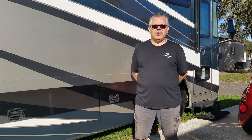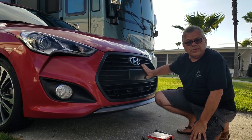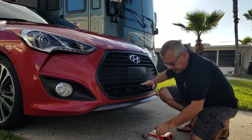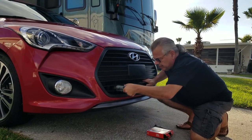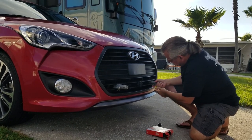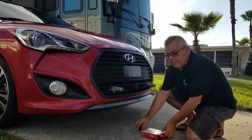We're going to show you how we prep the vehicle for towing day. This is the day before our move. One of the reasons we went with Blue Ox was it left a nice clean look across the front of the car — from a distance you really can't tell it's set up for flat towing. To get it ready, all you do is remove a little plastic cover, take the piece that engages into the tow bar, press it in, and give it a quarter of a turn. That's all ready.